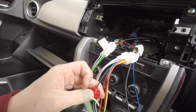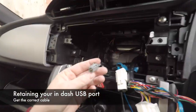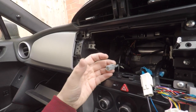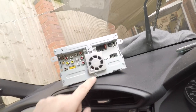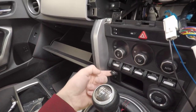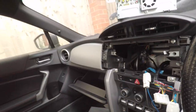For those who want to retain their dashboard USB port: I've got the correct part on order and will link it below. All you do is put it on the connector, and you'll get a USB cable that goes into the USB input on your aftermarket head unit, retaining that functionality. That should be all your wiring done now — aerial connector ready, ISOs ready.